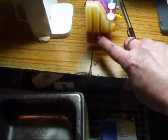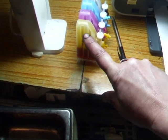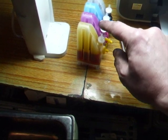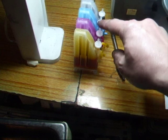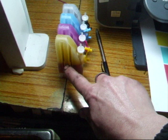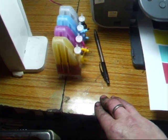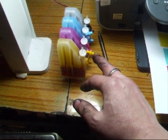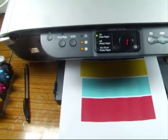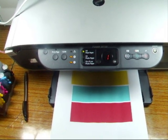Just one more thing before we end — here are your ink bottles. I only put a small amount in for shipping so it doesn't go everywhere in the package, but fill it up to about here. Make sure you take the small bungs out of the top but leave the big ones in the bottom, and put your air filters in each one — they let air in but won't let ink out if you accidentally knock it. Never let it run below 20ml because if you get air in the system it takes quite a bit to clear. Instructions on how to fill the bottles will be included in the pack. The CIS works great on the Canon MP150 — saves loads of money. Thanks for watching.